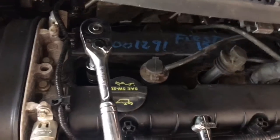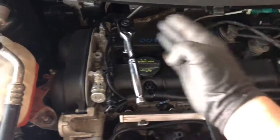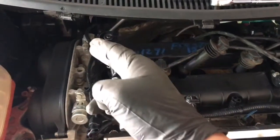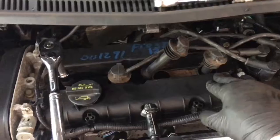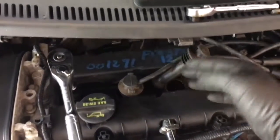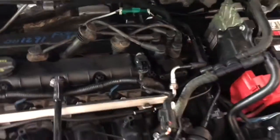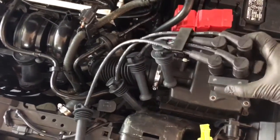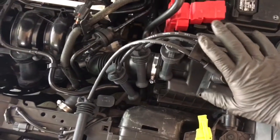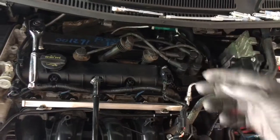all of the wires. And like I said, when the wires are here, there is really no missing it, because there's the longest one, then the third longest one, the second longest one, and the shortest one. So I'm just going to move them all out of the way and do all my spark plugs. And as far as me, since I'm replacing the coil itself, I already have the brand new coil here preset. I already put the wires here ready to go. So all I'm going to do is unplug it, unbolt that one, bolt the new one in, and that's it.